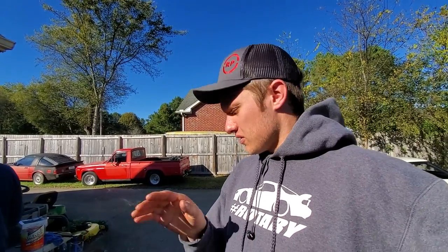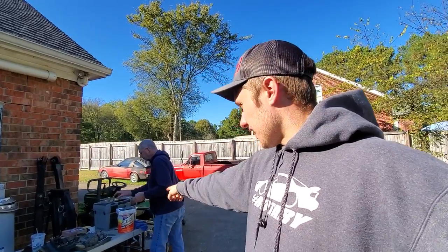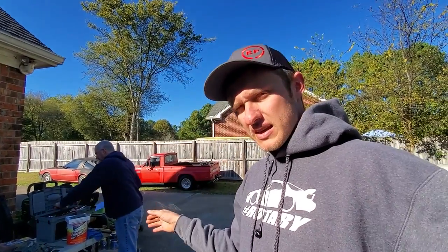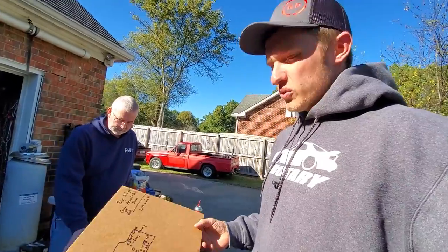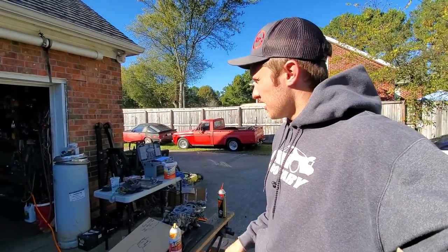Just my recommendation - and Charles will agree: take your time, go slow, clean everything, even the outside of the carburetor. Charles has an ultrasonic cleaner that doesn't require super abrasive chemicals. If you need to use chem dip, that stuff is hard on seals - so 10 minutes, take it out, clean it out, make sure you're not tearing anything up and that it's not etching. When you take stuff apart, make a list, make a cardboard cutout, lay everything out exactly how it needs to go so you don't forget.